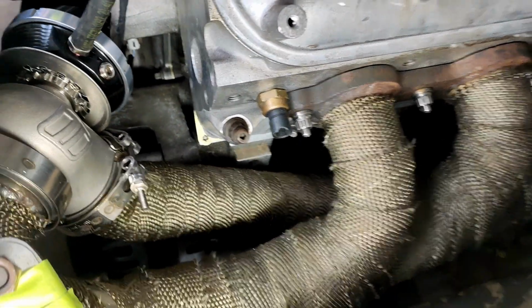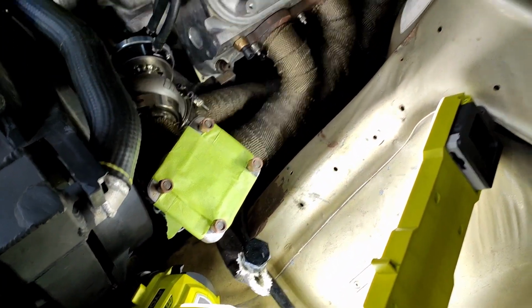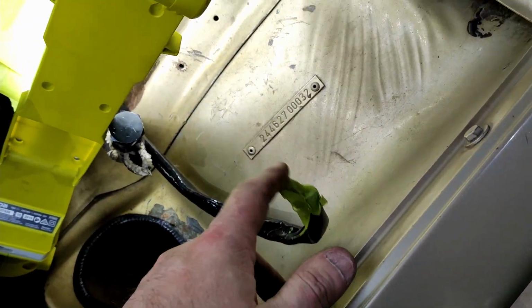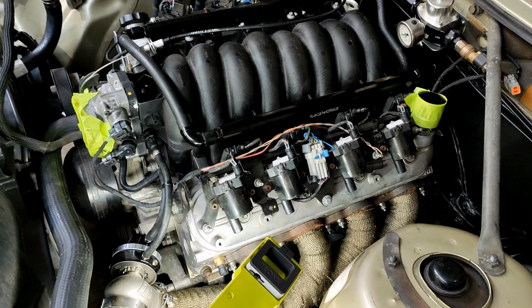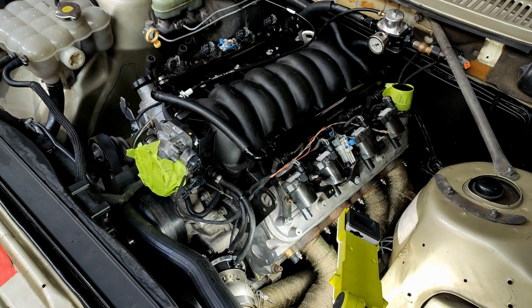So now I can put the turbo back on. I need to try and crank this and see if I get oil pressure out of this line, which is there. Let's see if I get oil pressure out of here. Maybe that's the next thing I'll try. Just got to remove all the spark plugs so it'll zip over pretty well, and yeah, maybe we're ready to do that.